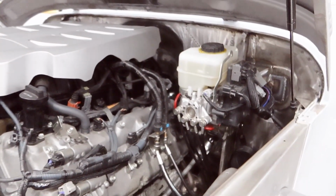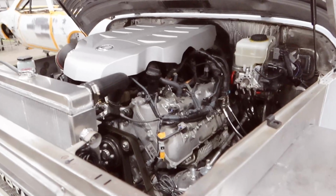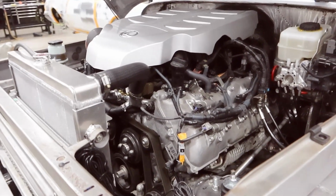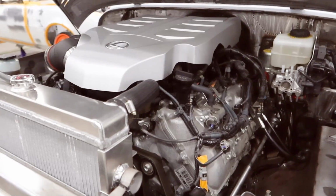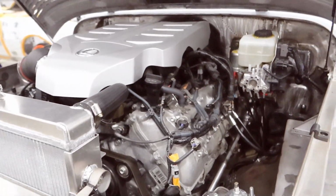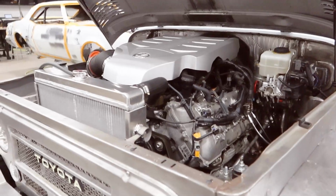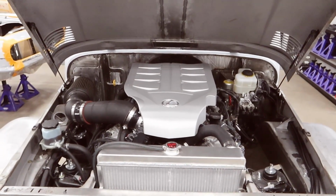That's amazing. I mean, when it comes to putting engines where they don't belong, we're pretty familiar with that. So I mean, it belongs on this chassis but doesn't belong in this vehicle. So the fact that you guys had to move everything around and you're still able to retain a lot of the factory stuff, mainly because you have to. It won't work if you don't. Yeah, this is not one of the computer systems that's friendly for modifying and adjusting. You pretty much have to play by their rules, and then kind of cheat them as you can. And like I say, there were a few little things as far as the emission systems that we kind of had to defeat and come up with different little fixes, like pressure sensors, just to trick them, so the computer's happy and we get it to do what we want it to do.